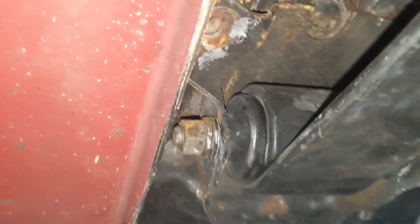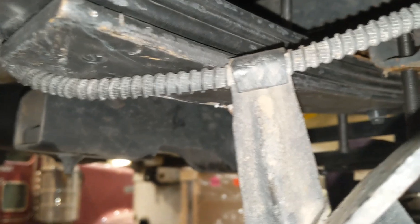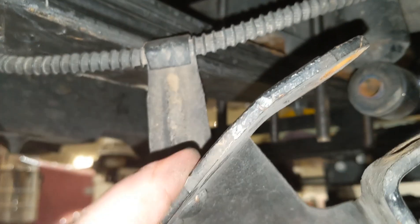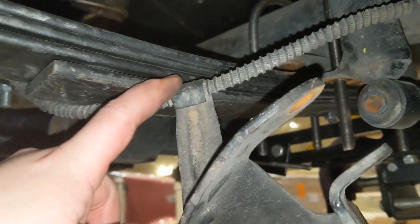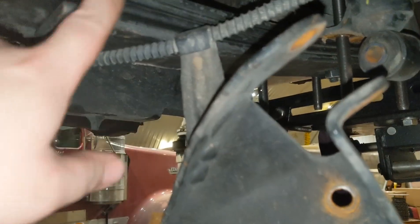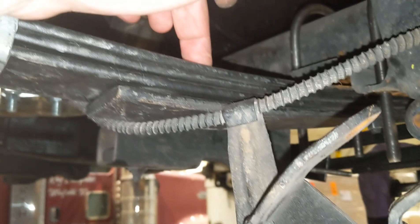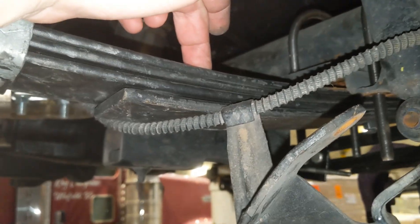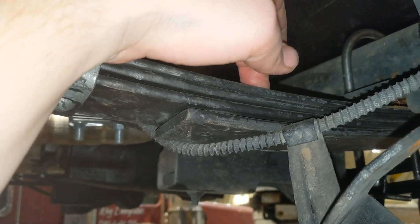Finally got it in position pretty much, but I'm not liking the look of this. Apparently, after reading on it some — if you go from a mono spring setup, the parking brake was run under the spring, but on the multi springs the parking brake cable is supposed to go on top of it. So after fighting to get this in, it's not gonna work and I'm going to have to take it back out.